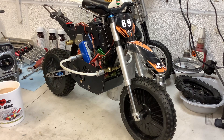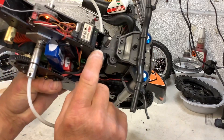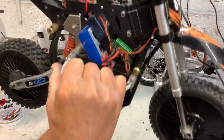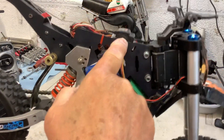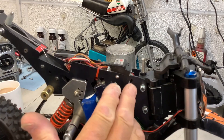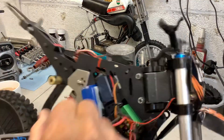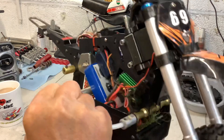It's really nice — it's one of the best modifications you can do for this bike. I did have the gyro in there without the case, but I think it's better having it up that way. Because I was getting a bit of interference from the gyro from sideways movement. Now it's only got that one axis. You can see on the gyro it's got an arrow on there for where it's supposed to be mounted — it is supposed to be in that plane, which is exactly right. So now it's just one way — that's all it does.